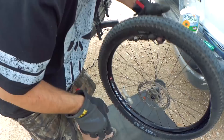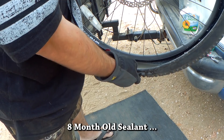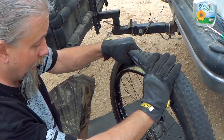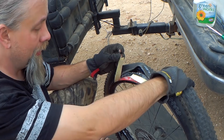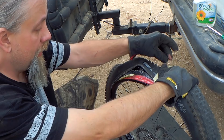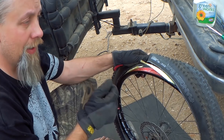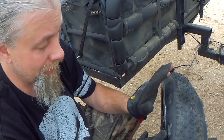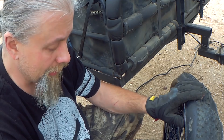You can see it's still very liquid in there but the sealant just stops sealing after a certain period of time. I'm going to dump this out. What I see here is Stan's rim tape, and it doesn't do a very good job of securing the rim. I'm going to take this off along with the factory red vinyl thing — I think that's for tubes. I'm going to clean everything and use one-inch wide monster tape instead, because that's what I used on the back wheel and it seals the spokes a lot better. I'll get the valves out, put new valve stems in, re-tape, and put brand new race sealant in — it's extra thick — which should solve my spoke leaking problems.